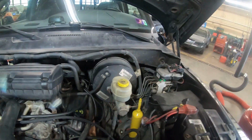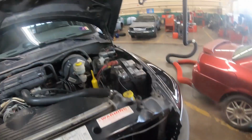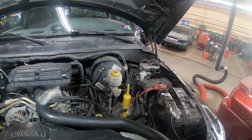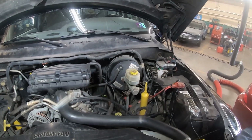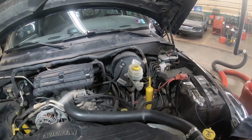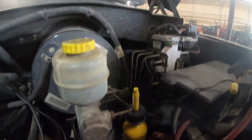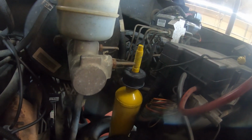All right, we got him working underneath, tightening that up. Because we got it lined up finally after grinding a bunch off, now we can move along to the top bracket. That's what's going to be next. He's just tightening it up with a ratchet for now. When we get everything tight, we're going to come through with the torque wrench and torque it. But before we put the bracket on, you got to make sure to put your retainer and your bushing in there first.